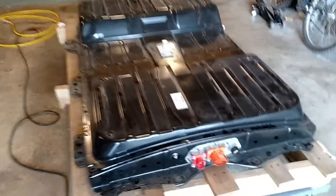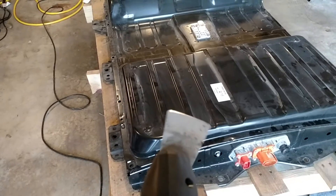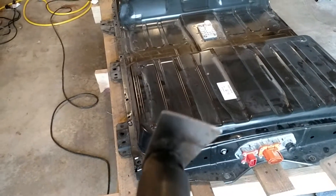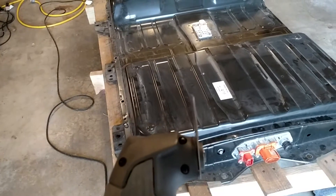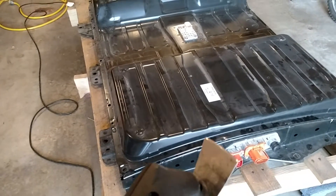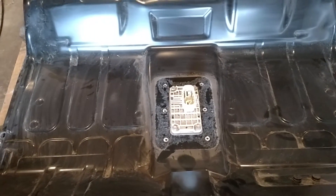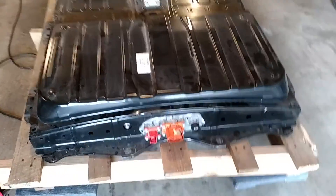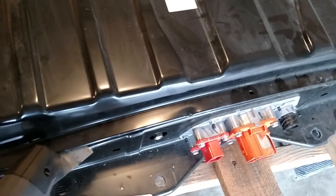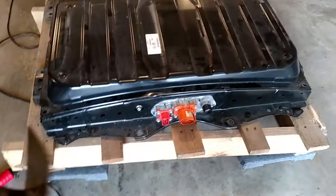Hello and welcome to this video. I've spent the last hour or so using my trusty oscillating tool here — it just moves a little tiny bit but a little blade cuts through all the gasket material pretty good. I removed what looks like five bolts on each side and then six bolts in the center, took the little plate off that was sealing it in there, and went to town with this. I put it in at an angle so I got the blade on there at an angle and just pushed it through all the gasket material. It took about an hour to do it.